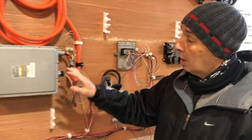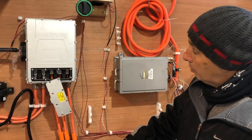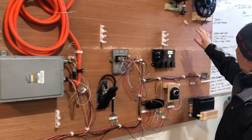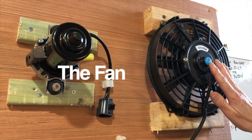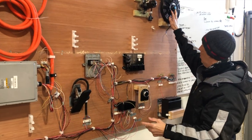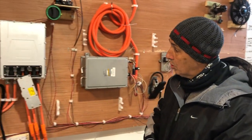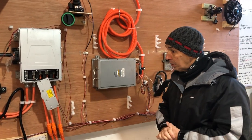The charging unit here can get quite warm, as can the motor and the inverter, so these have liquid cooling. Because we've got that, we need a radiator to cool that stuff down — and hence the fan here. The fan is controlled from the brain: if a temperature sensor says the liquid's getting hot, it will turn on the fan to give extra cooling. We also need a water pump, of course. This item here is just the water pump to circulate the water around the system when that's plumbed in and wired up.